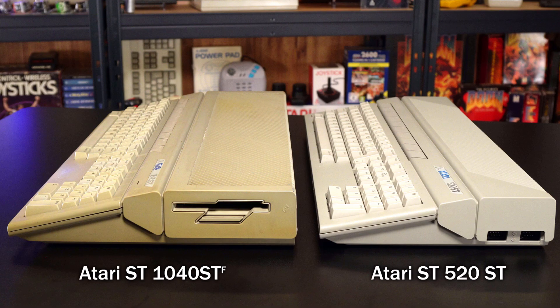Thanks Rob. That's right, I am indeed one of the world's leading experts on Atari ST floppy drives - or at least the only one that was available at such short notice. But either way, I am more than happy to help you out with your floppy drive conundrum. So way back in 1985, Atari released the 520ST, the original Atari ST model. If we take a closer look at this, you'll no doubt notice that the back part of the case is actually quite a bit shallower than we're used to seeing in later ST models, because this didn't have an internal floppy drive. So they released it with an external drive called the SF354. This was a single-sided, double-density, 3.5-inch drive with a capacity of 360k.